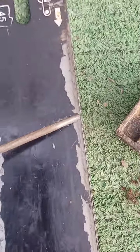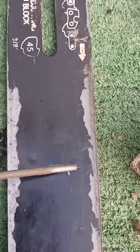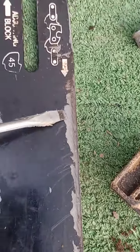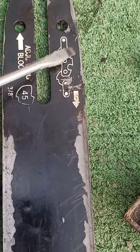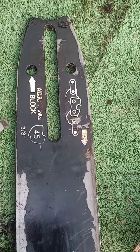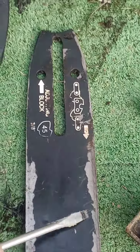As I say, if you're sharpening everything, it's not going through, this is why. That burr. Yeah. Can you hear it? It should just slide straight off that. Let's go to a bit where there's no burr. Actually, there's a little bit just starting right there, but there's no burr here. Slide straight off. That's what you want. You want the things to be able to slide straight off and not grab anything.